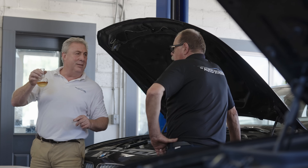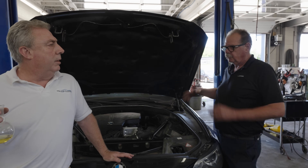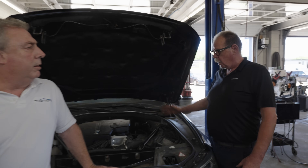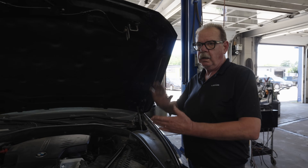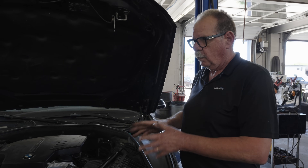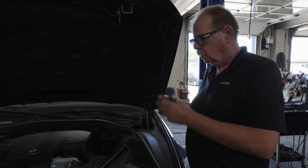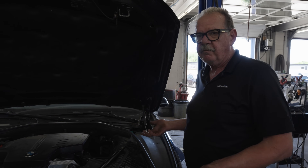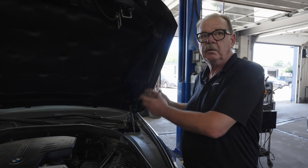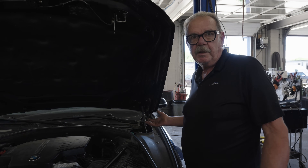John, you got an experience with water and the brake fluid like this? Yeah, for sure. There have been instances where people have been driving along, say, a two or three-hour drive in the heat, and they step on the brake and the brake pedal goes to the floor. They can't stop the vehicle. They hit something or whatever — it's not good. But what will happen is they'll come out of the vehicle, it'll cool down, and all of a sudden you have a brake pedal again. They couldn't figure out why until they'd done some testing and figured out that it was the brake fluid that was boiling, especially after a long drive.